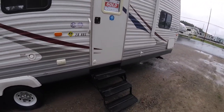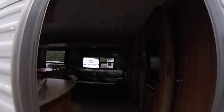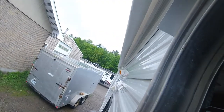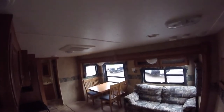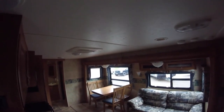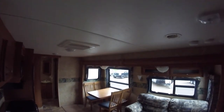And your stairs to go inside. Inside, you have your switches for the slide-out and your power awning — the awning extends and tracks. The slide-out is all the way out right now. When you push it out, you'll hear a clicking sound, which means it's at its full extent. Make sure the slide is either all the way out or all the way in to make a proper seal, so you don't have air and water getting in.